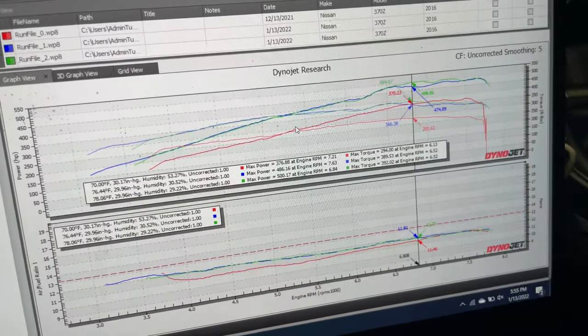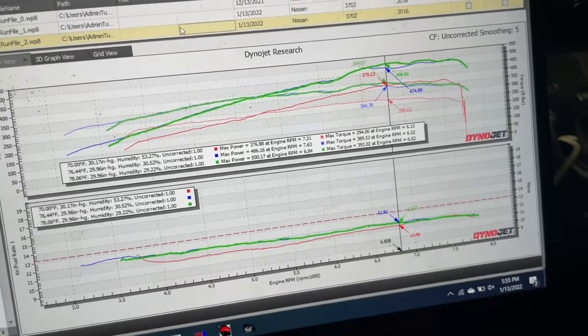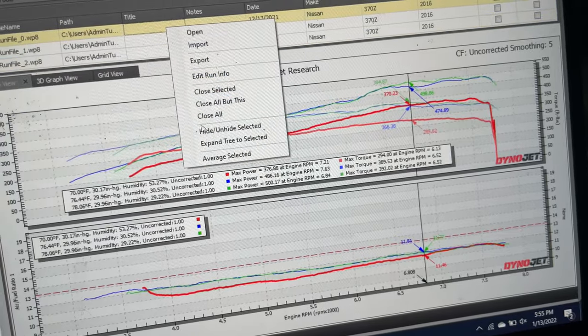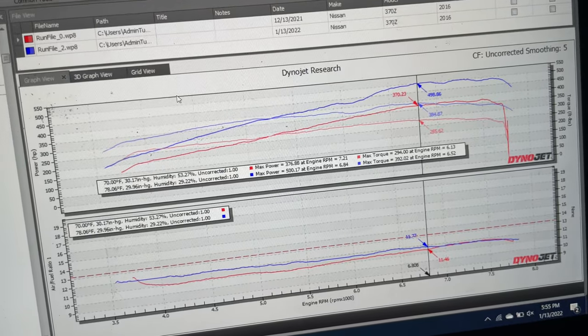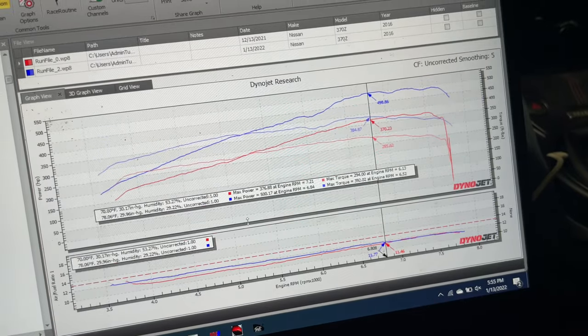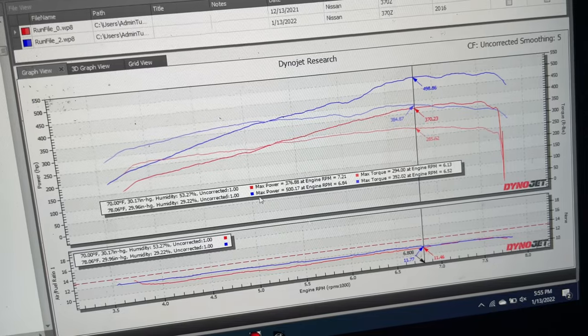The belt hooked up a little bit more and it made 500 wheel horsepower on the dot. A little bit more torque. Overall, decent gain so far. The only thing is we could probably push it more, but 91 octane is the main thing here. That's the main concern. So I'm going to add a little bit of timing, make one more adjustment, and then see what it makes.